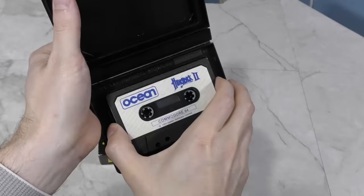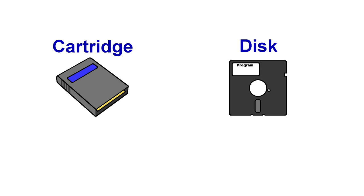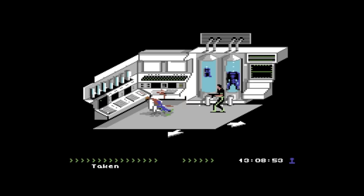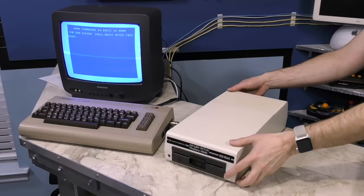The C64 was initially treated much the same as the VIC-20, with the early games being on cartridge and cassette. However, it didn't take long for the disk drive to really take off, especially in North America. Cartridges still held 16K, but using a disk you could load programs that could utilize all of the C64's RAM. In fact, a game could be much larger than 64K, only loading in the parts that it needed when the time came. Thus, games on disk tended to have much more complexity, better graphics, and better sound than games on cartridge.